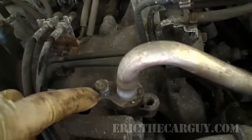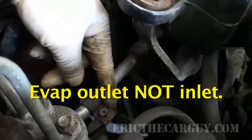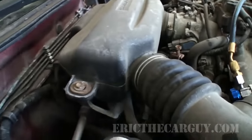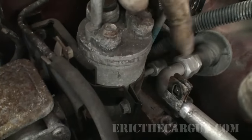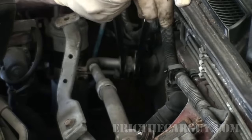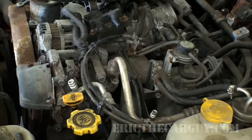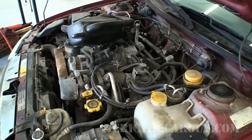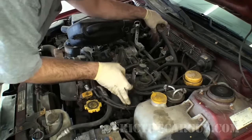The next thing I'm going to do is remove the line and see if I can repair it. To remove this line is fairly simple. Right here on the inlet of the compressor there's a fastener, and there are a couple of clamps underneath. It travels back from here all the way over to the evaporator inlet on this side. There's a bracket here and another bracket up underneath this intake assembly. You want to be careful not to get any dirt or moisture in the system.